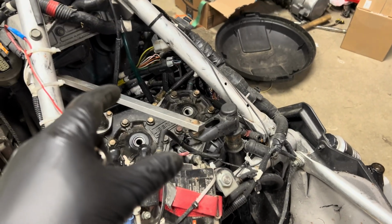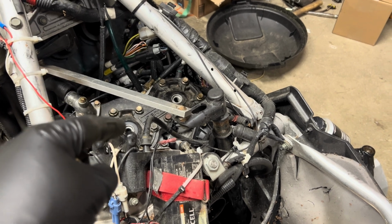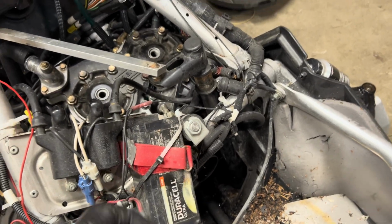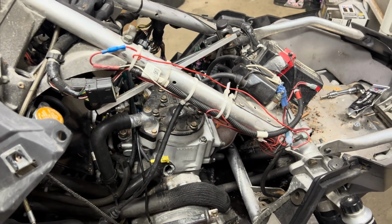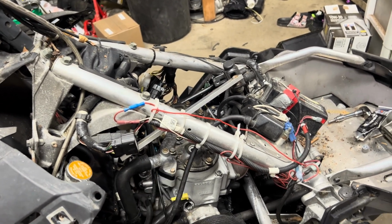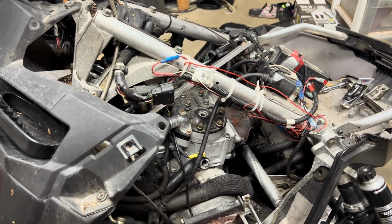A lot of times these O-rings for the cylinders are a little bit small. I had issues with the inner ones around the combustion chamber being too small, so they roll out of the groove. I just wrapped them around this battery and let them sit for 5 minutes. Boom, it actually worked perfect. So now moving forward, I am going to torque down the head. All these bolts, I got to torque them down. Now I'm gonna start hooking up hoses, and move on from there.